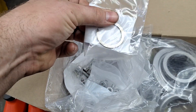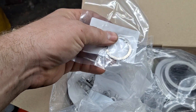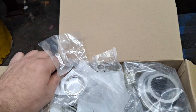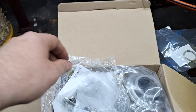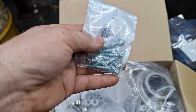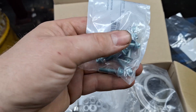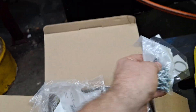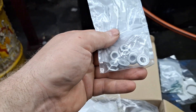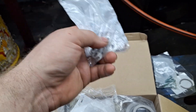Here's your snap ring that holds the clutch in on that inner shaft. It's good to see that in here — that's a one-time use snap ring. Also included are bolts you don't even have to replace, but they included them in the package. These are for the clutch actuators — it's good to have new bolts like that.